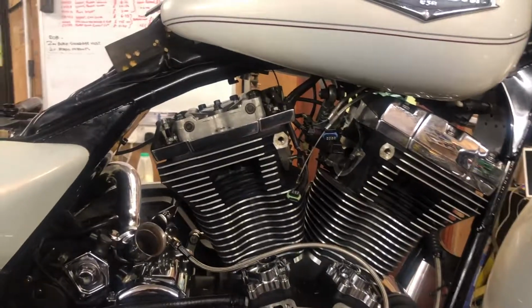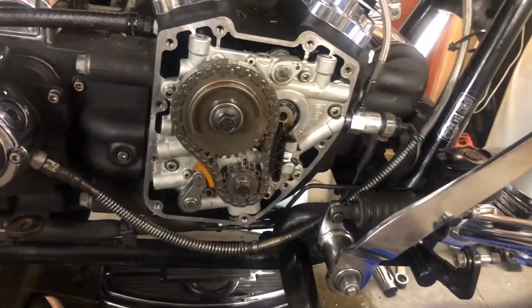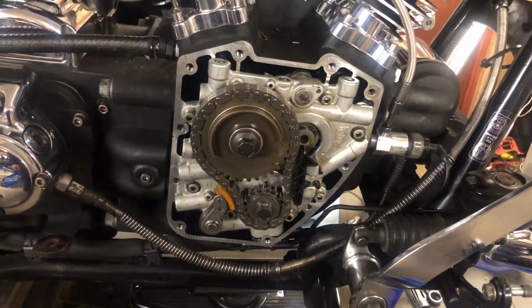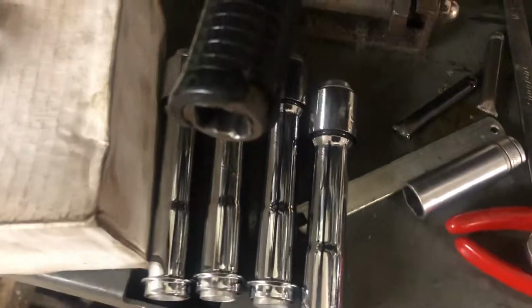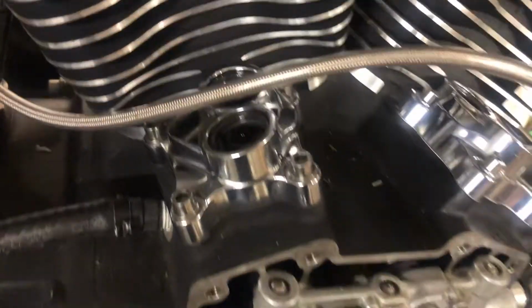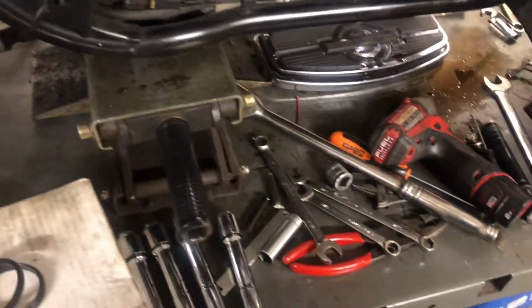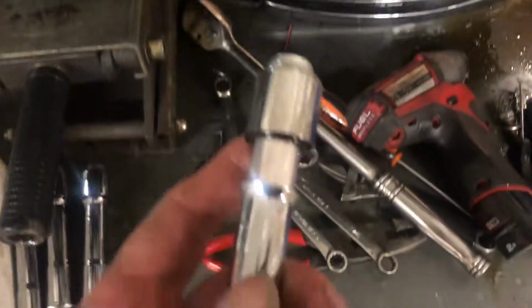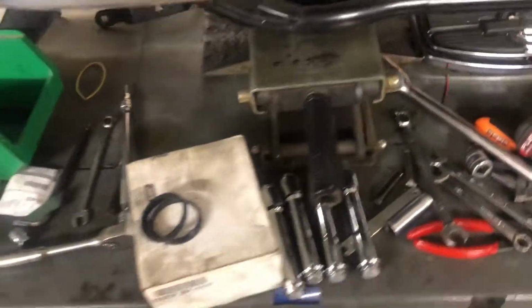Right, that's cylinder head on, rockers all assembled, all stuffed on, torqued up, sorted out. We spoke about timing gears already, that's all done and dusted. Now, moving on to push rods and push rod tubes. I've already assembled the new push rod tubes. So, I've got all the new seals in the tappet covers and in the cylinder heads. I just give them a wee coat of assembly lube to help everything slide together, and the same with the inside of the tubes. Hopefully that keeps the corrosion at bay for a wee while.